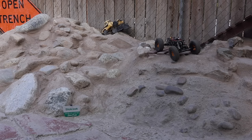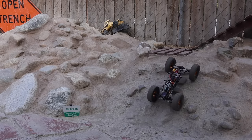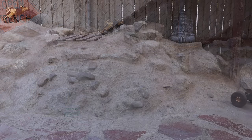I guess because of the nature of the dig unit. So it is held out of dig. Like I said, there's the gear in the middle and a spring on either side of it. So it's held into four-wheel drive, and you have to push past that spring. So it will automatically recenter out of dig all the time. So the dig responsiveness is so fast. It feels almost instantaneous. That's pretty crazy.